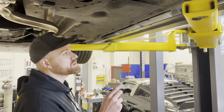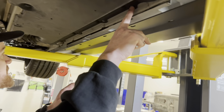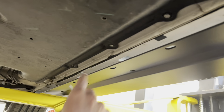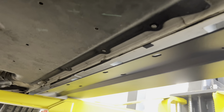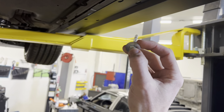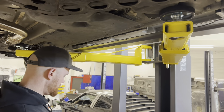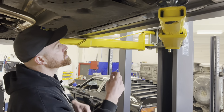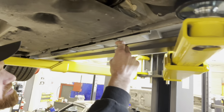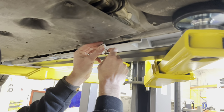And I'll show you some of the first screws we'll put in to get it aligned. Okay, so in this guy right here, you can see there's 1, 2, 3, 4. These are OEM threaded holes that go into the metal. And so I'm going to take one of my machine screws, which is the M6x50, put a washer on it, and then I'm going to put 3 washers here as a spacer, and then 2 of our 1/2-inch aluminum spacers.